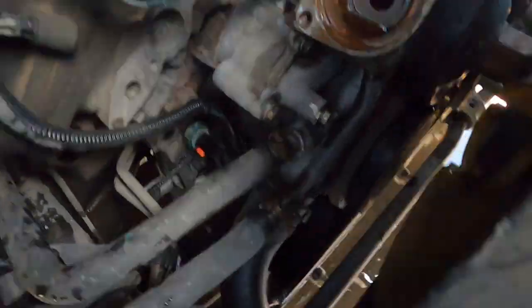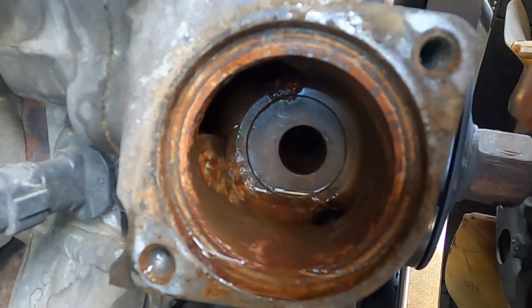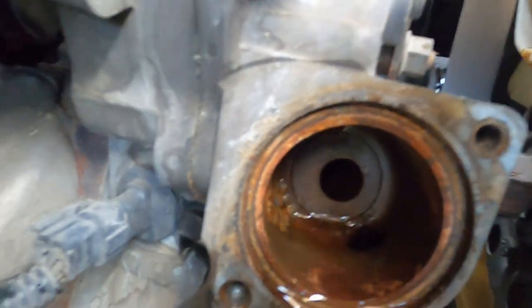Let me show you what I did — I stuck that water hose right on that hole in the thermostat housing and let it run out the lower radiator hose. It just kind of goes in there, and that one down there goes to your heater core. I made sure all the water coming out of that radiator hose was clean. So we're gonna put it all back together, fill it up, fire it up, and see what we got.